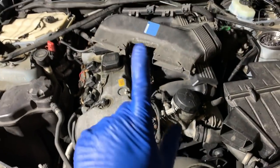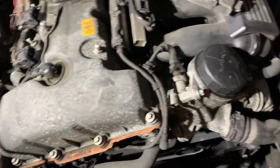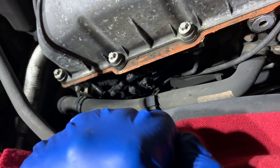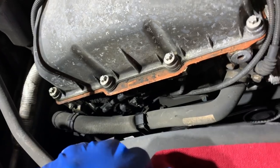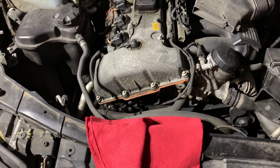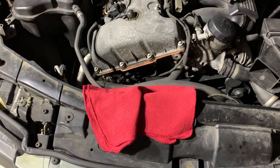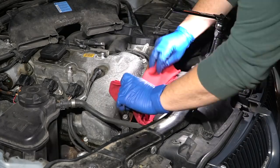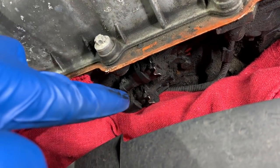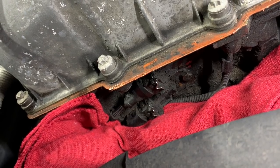Now that I've taken this portion of the air intake off, you can see I've got a little bit more space to work with. The next thing I'm going to do is set these rags down inside here. There are two 10 millimeter bolts — you can't see them right now, but one each holds these solenoids in. I don't want to lose those down in the engine bay, so the rags will hopefully catch them if they fall. These solenoids are also connected directly into the upper end of your engine, so there's a lot of oil in there — the rags will help catch any oil that might drip out. I'll go ahead and remove the connector and take out one solenoid at a time by removing that 10 millimeter bolt.